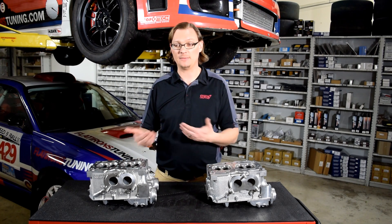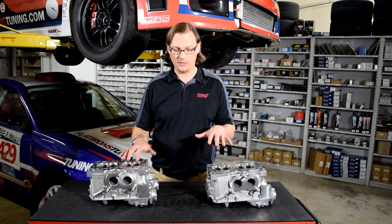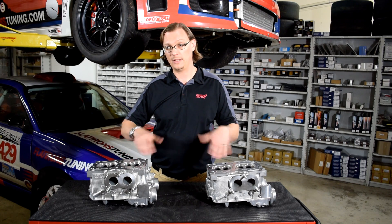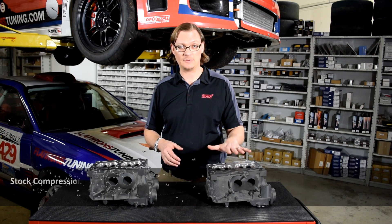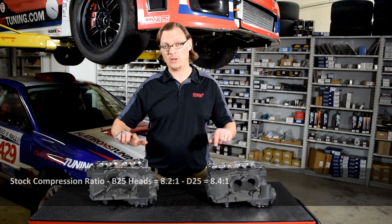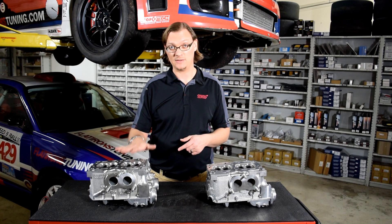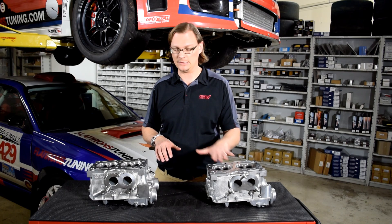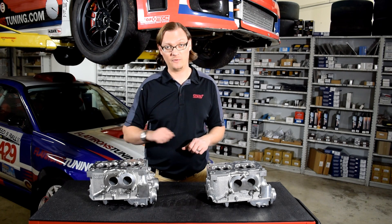It's almost similar to doing a hybrid head swap in a WRX. With those variants in combustion chamber volume, the way Subaru got these to the target compression ratio — 8.2 to 1 for the B25 head and 8.4 to 1 for the D25 — was by also changing the pistons. The pistons were designed to match the cylinder heads: B25 pistons have a shallower dish at about 22cc, while D25 pistons have a deeper dish at about 24cc.